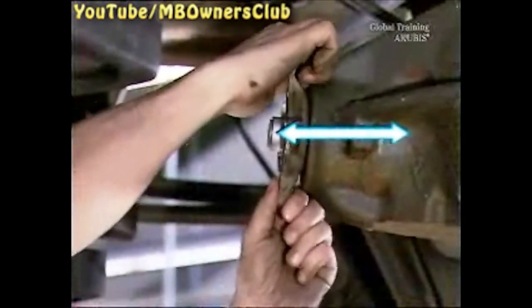Another sign of a damaged axle gear is rough running or play. Should you find damage, you must renew the complete axle. With us, however, everything is okay, so we close the drain oil plug once again. Tighten with a torque of 60 Nm and turn the plug another 90 degrees.